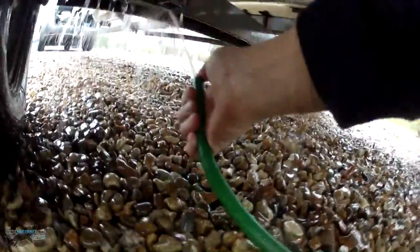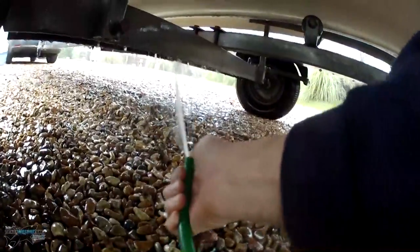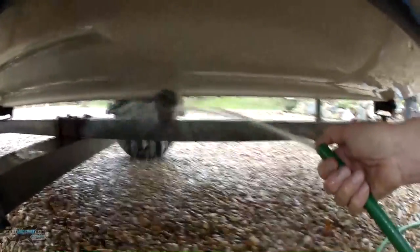Your mudguard could fly off. The inside of the wheels I give a good spray to as well. Most important, I feel, is spraying up underneath the axle, across where the suspension bolts are — I've got six on each suspension unit. You really can't spray too much fresh water there. That's been underneath the boat. I do my rollers too.